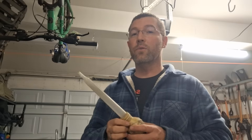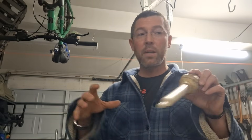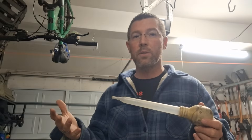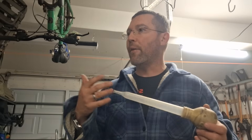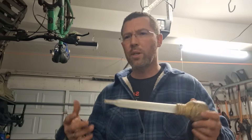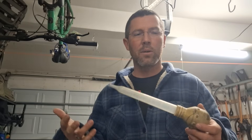This turkey baster is a very useful tool — just siphon all the old fluid out of the reservoir, spit it into a container, dispose of it properly, then fill it back up with new brake fluid. After maybe a month, or at your next oil change, do it again. Keep repeating and eventually it'll come out clean.